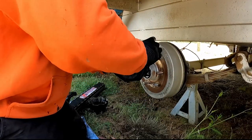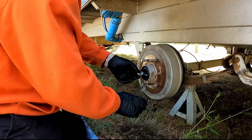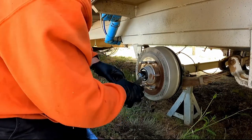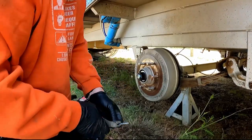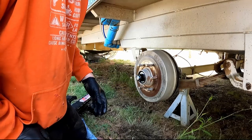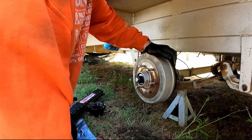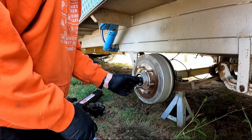Now you're going to be replacing this pin. You don't reuse them. There we go, off it comes, just stick it in there for now. And then these are only done up literally hand tight to get rid of that play. All you want when you do these up is to get them tight enough to take the play out. So to tighten this one up, it would have been one castellated section. Anyway, let's undo it. Don't overdo these because they will seize up.